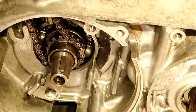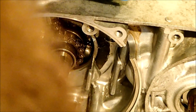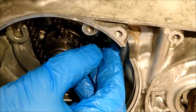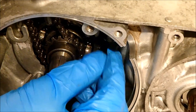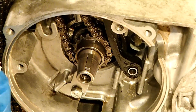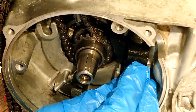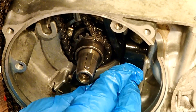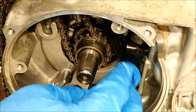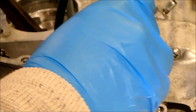With the C-clip on the end of a pair of pliers, I'm going to see if I can push it on. Next is the cam chain tensioner — the forks go between the two washers like so, then plug into the cam tensioner. That should give us the adjustment, and before I forget, I'm going to put the locking nut on top.